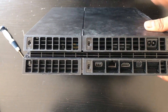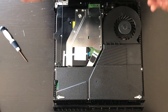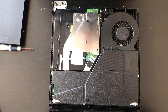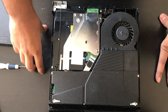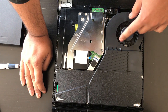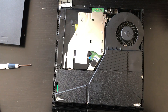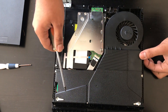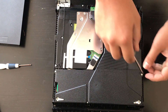Once you've removed all the screws, we're going to remove the bottom case by lifting it from the back. According to the client, there was a lot of dust in the fan here which he's cleaned out already. In most of these cases this fan is going to be really dusty in here as well — you're going to want to clean it out, but we're taking everything apart and cleaning everything out regardless. So we're going to take the power supply out and remove these screws — there's five of them.